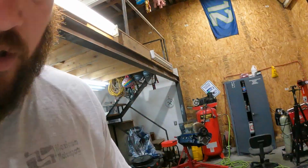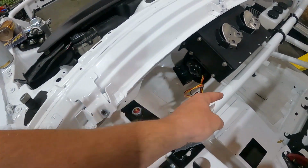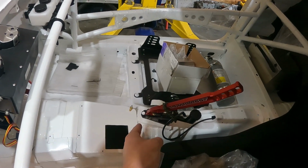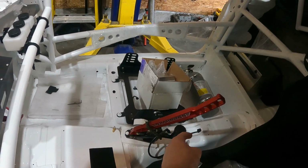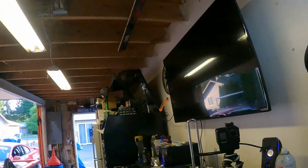We basically found an issue on my car that we realized we needed to fix on his car. So getting that pump put in, but right now we're going to run the rear brake line that goes from the right side master all the way along to a brake bias adjuster, straight out the same hole as the handbrake, and all the way to the back to tee out. And then we'll go to the rear calipers. So we're going to get something done today, and you guys will see it on time lapse.